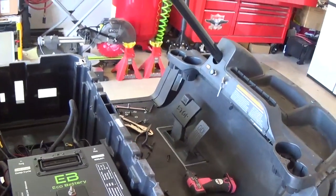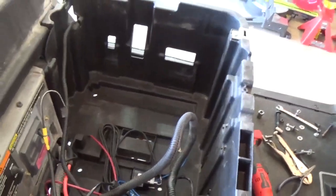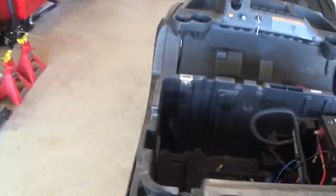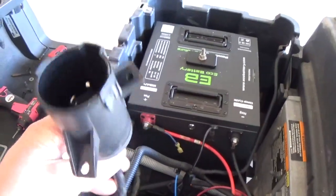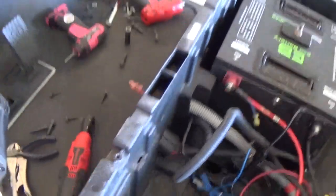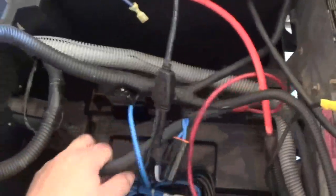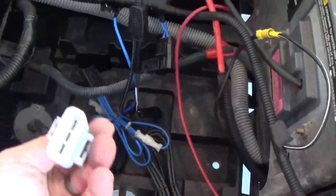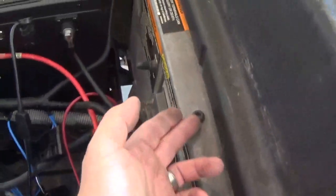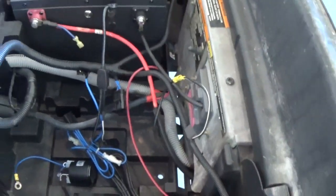What I want to do is finish going down a little farther. I'm going to pull the Eco battery out and we're going to pull this wiring harness out. With Eco, they actually make it so you just plug an extension cord in. This R2-D2 looking thing is actually replacing the original charging port. So instead of having all this extra wiring going back to the computer, we're just going to plug this guy in, and then this will plug into our Eco charger and we just use an extension cord. I'll have to pull the screw out here and lean that forward to get at the back side of this harness.